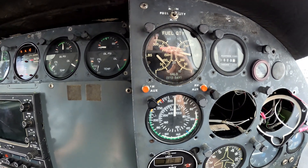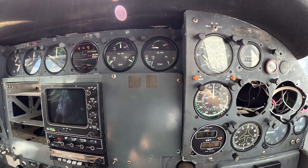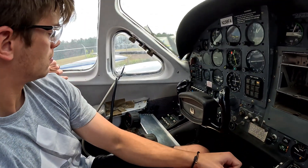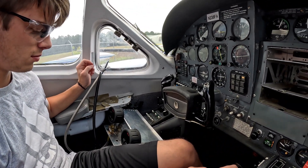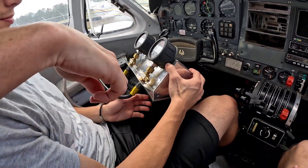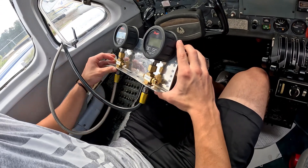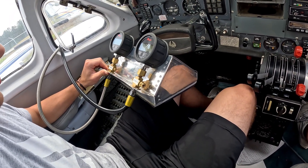All right, cool. So when you're doing this setup, you're always going to let the engine come up before you're looking at gauges. We're kind of already warmed up, so we're not going to be concerned about that. When you first set the gauges up, you could have air in your lines — like these two lines that come off. What you want to do is push the air out of the lines before you turn the gauges off. You see that it's fitted with these two knobs. If you push on those, you're going to get fuel all over your stuff. That's why we had the bucket before.